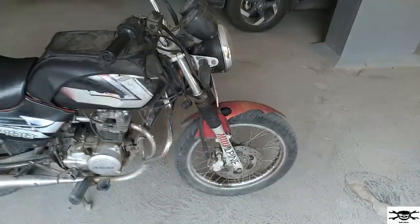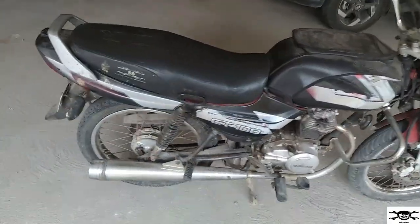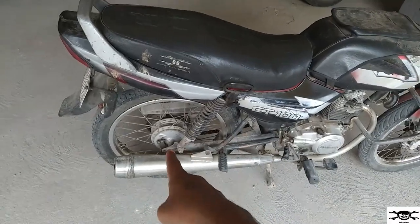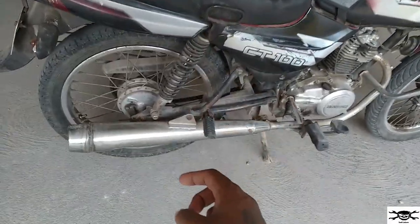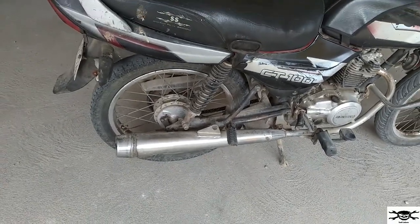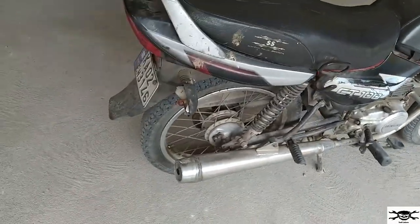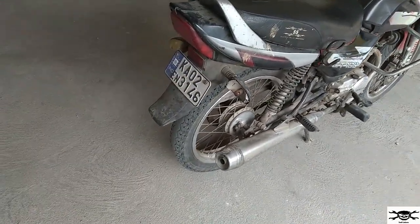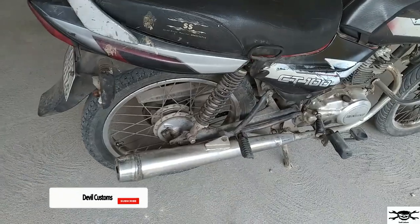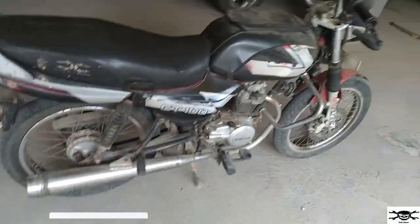Okay, so it's here. So in my next video I'm gonna remove this rear section along with the wheel and the swing arm, and install the swing arm of FZ. We are not going to do mono suspension, we are going to install a dual suspension as it is in this bike, because the size of the wheel and tire is very small in this bike, so we need a good road grip. That's the reason I'm going to install FZ swing arm in this.